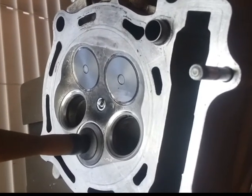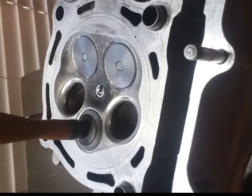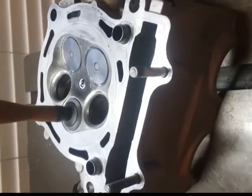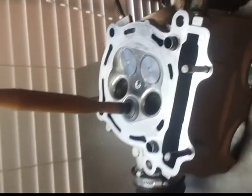Make sure it's smooth all the way around — no shiny spots at all, because the cutter will leave shiny spots. You've got to lap it until they're all gone. Then you take the new titanium valves, drop them in the hole, and put them together. It's a pain in the butt and it's really tedious, but it works.